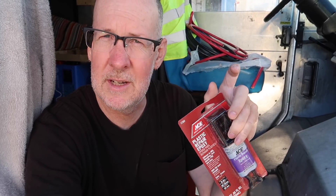I'm going to use this to repair the hole. One tip is scuffing up the plastic with some sandpaper before applying it. Then after it's all sealed, I'm going to use a little gizmo to measure the acid levels, take a bit of acid from the other battery cells to fill this one back up so they're roughly all equal, and then top them all off with a little water. That way all the levels and acidity are roughly the same in all the cells, so I don't have just one cell that's low.